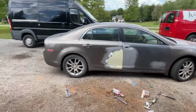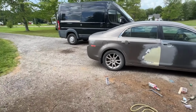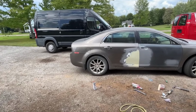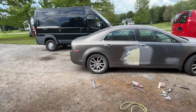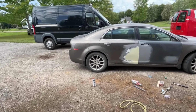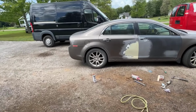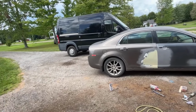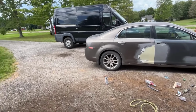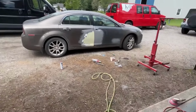The next video, we're gonna start on the rust on the other side. We're gonna knock it out in one video. We're gonna cut the rust out, weld in some new pieces, we're gonna use weld through primer in the back of the metal, and then we're gonna use some short strand fiberglass as our first coat of filler, because there's probably gonna be pinholes in the welding because the metal is literally like a pop can. And we'll fill it with that, and that's gonna keep moisture out, hopefully to help it last a little longer, and then we'll use regular filler over top.